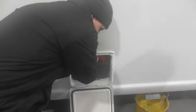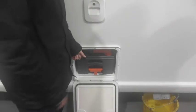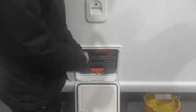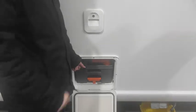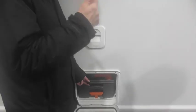Drain down for your flush tank — it's on a little ledge here, this rubber pipe here. That you need to drain down for winter; do not leave anything in there. The best thing to do is flush it — use the flush system. Press the button, flush it out as much as you can, then drain the last little bit through there. The reason we use the flush pump as well is to get the water out of the pump, so any water trapped in the pump doesn't freeze.